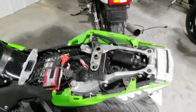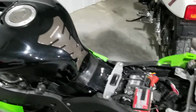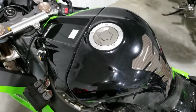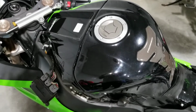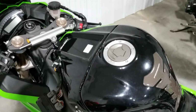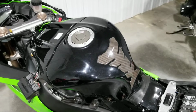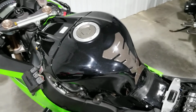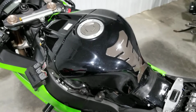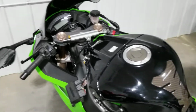You still have to do all the steps in the back, taking that apart. But the ECU is next to the air box. So we're going to be taking the tank up, meaning it swivels up, accessing the air box. While I have it out, I'll put a Sprint P08, because with 10,000 miles, I'm sure this air filter is disgusting. While I have it out, also at 10,000 miles, I'll be putting some new spark plugs in it as well.